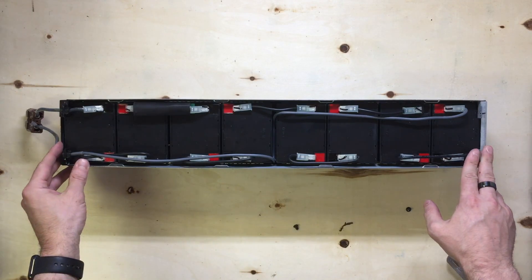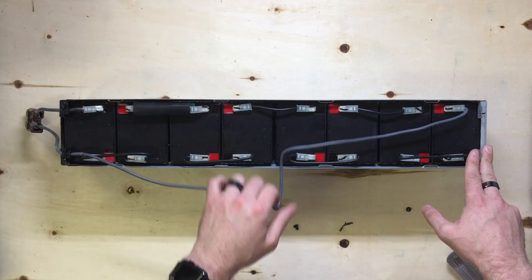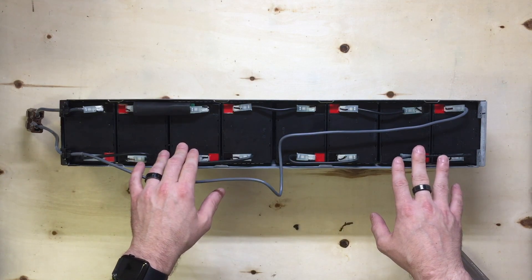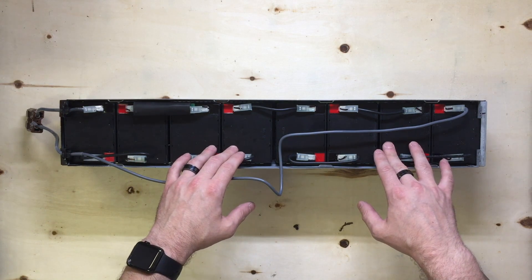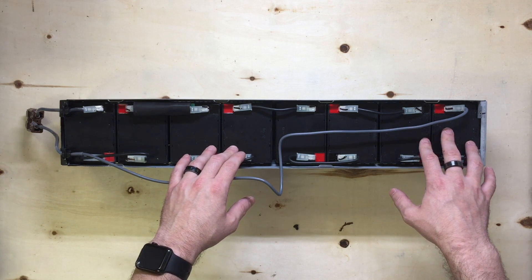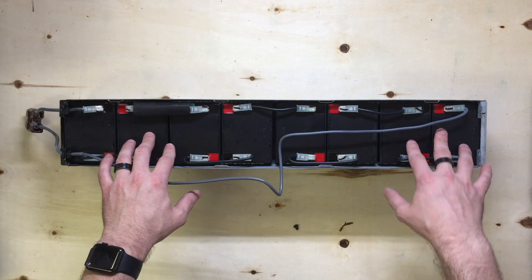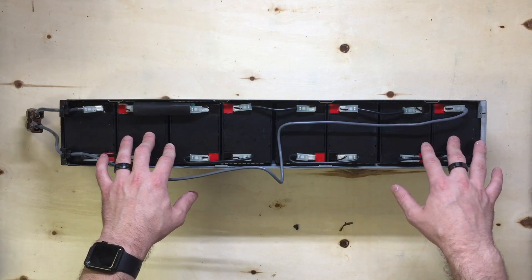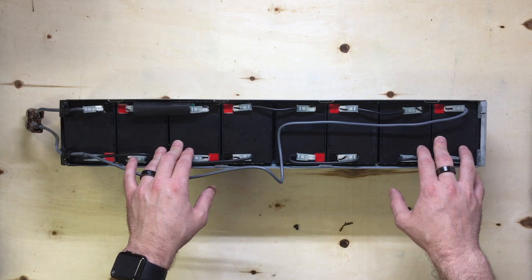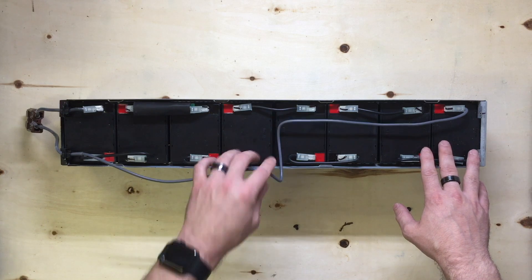This is the pack. It might look a little complicated if you haven't done it before, but it's actually pretty simple. Basically what we're going to do is take all the wires off the pack here at the very beginning, and then take the batteries out all in one go. I have included a diagram in the description that you can take a look at if you get confused — it shows you basically how the batteries are placed, positive and negative facing, everything you would need to know if you started from scratch. So don't freak out. The first thing we're going to do is start taking the wires off.